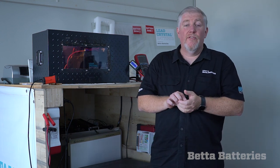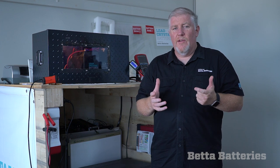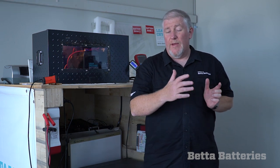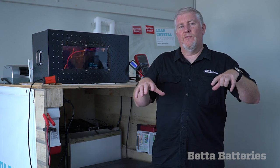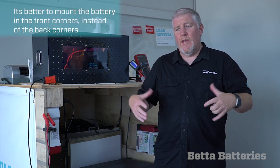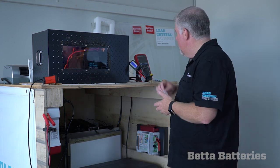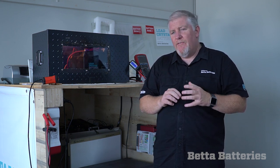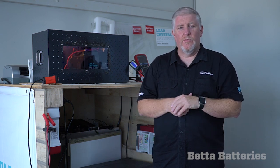What we've concluded from the data is that when you put a battery under a bonnet, you've got it next to a big baking oven called an engine. A lot of modern common rails can generate quite a lot of heat. Many Nissan Patrols have a turbo on the left-hand side with a battery mounted right next to it, which causes a lot of heat radiating into that battery. We find that if you mount a battery in the front corners behind the headlights, they'll have a much better time than batteries mounted in the back corners, where heat washes out of the radiator across the engine and wells in those back corners. The back corners is really not an ideal location for batteries — V8 Land Cruisers generate a lot of heat there, but generally back corners we consider a bit of a no-no.